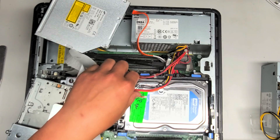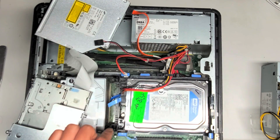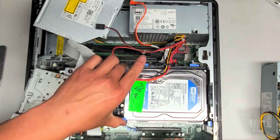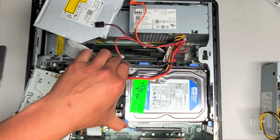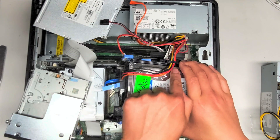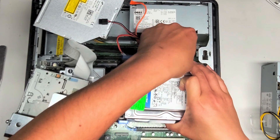Then we got to remove the hard drive here. The hard drive is held in with these as well — there's these blue latches here, and to release it, you have to squeeze these two, and then you can pull this up and it swings up like this. You want to be careful lifting this out. We're going to have to guide these wires out from this latch here by sliding it over to the other side.